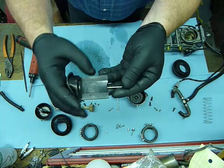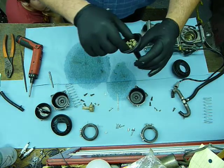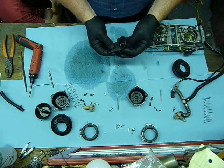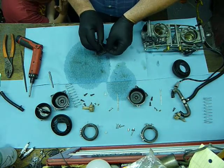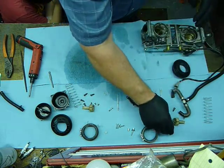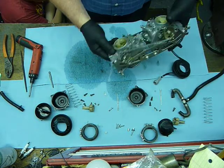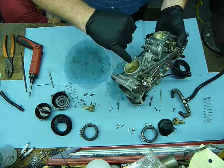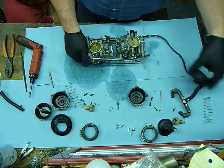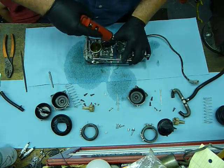You can see some of the residue from the bike sitting, and what happens with modern fuels when bikes sit. The remaining fuel that's in there is kind of stinky too. Slides are out. This kind of white residue is fairly common — I'm not exactly sure where it's coming from, but I believe it's associated with the alcohol in a lot of modern fuels.